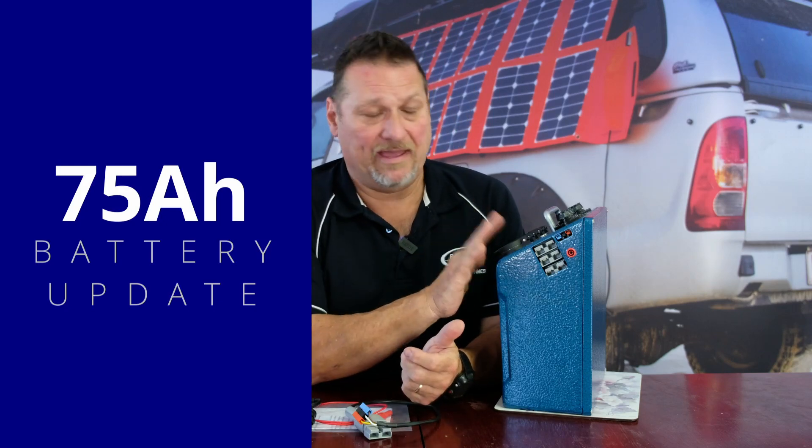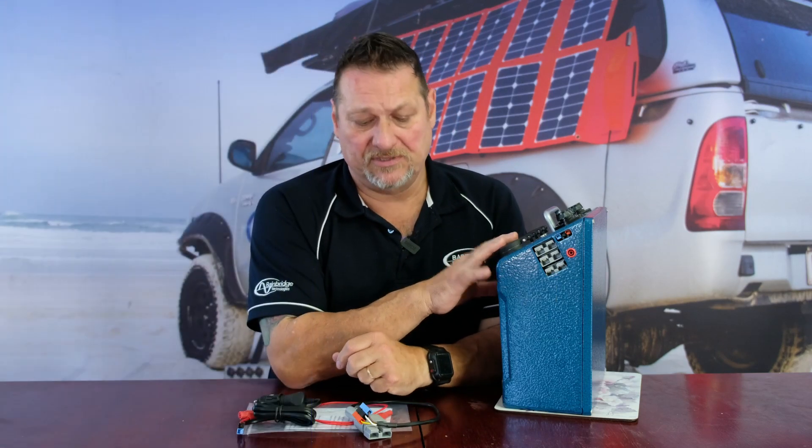On the model with the DC-to-DC built in, we've also put in our new upgraded DC-to-DC board which allows for a bit more flexibility, especially with modern vehicles with smart alternators. With the older system, you had to rely on the vehicle's voltage system and charging circuit to work within the parameters of the voltage sensing relays in the power top. Not all vehicles were successful in doing so.